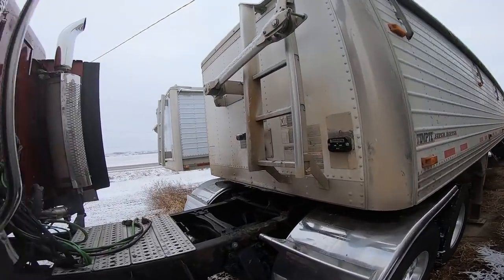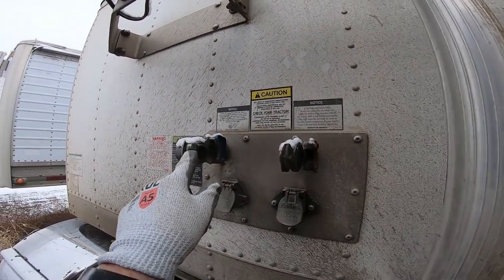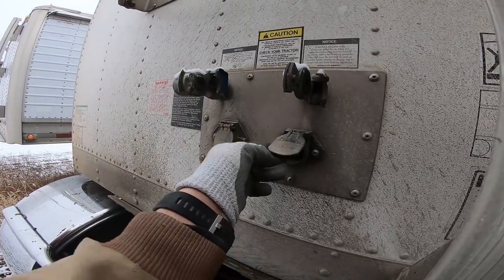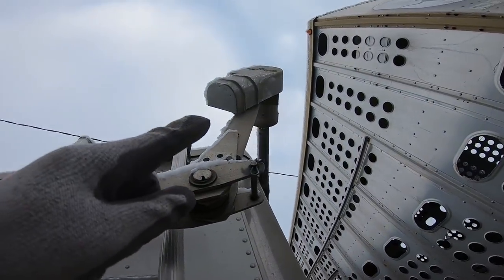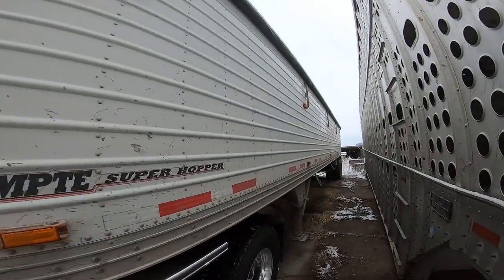Now we'll go back and hook everything up. I've got my emergency brakes — which are my parking brakes — my service brakes which is my brake pedal, my trailer lights, and my power and ground for the tarp. The crappy thing about not having enough shed space is when it snows you can't just roll your tarp — you've got to sweep off the snow. Goals for the next ten years: get a big cold storage shed or heated shop. I'll take this over to the shop and get it ready. For my pre-check I always grab something to hit the tires with — a hammer or whatever — and I always put my hazards on to double-check all my lights.